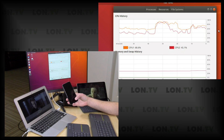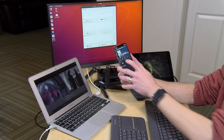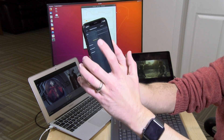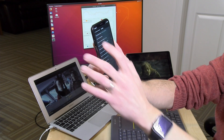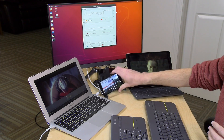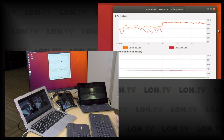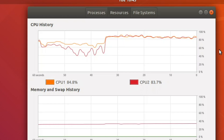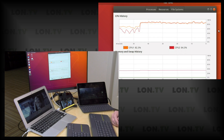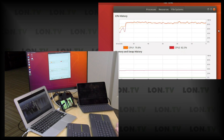Now I'm taking out my iPhone to begin the process of getting the MPEG-2 file going. I'll tap on that, click play, go over to playback settings, and change it to the same resolution as the others to be consistent. We've now got all three things playing at once, and it looks like we are getting smooth frame rates on all of them. Switching back to the performance monitor, we are hovering close to about 100% — about 80% right now — but everything appears to be transcoding just fine. I spent a good amount of time testing this yesterday and it remained at that consistent level of CPU utilization using hardware transcoding, although the MPEG-2 stream had a little bit of trouble momentarily but sped back up again.